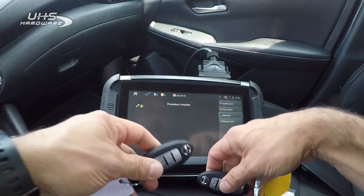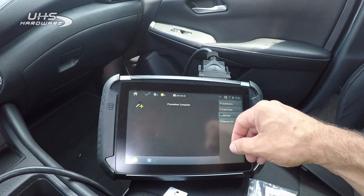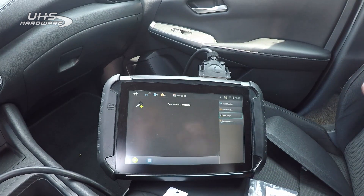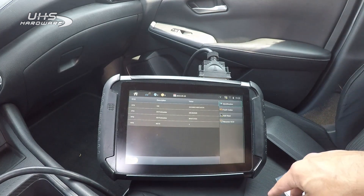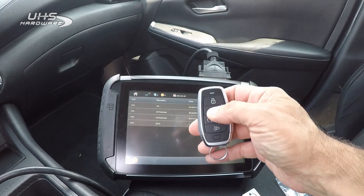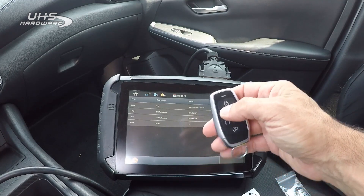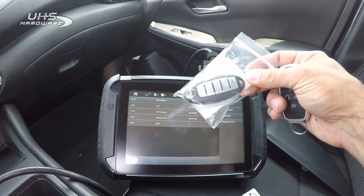We may have to plug in our gateway — I don't know why that one worked without the gateway, but let's plug it back in and see what happens. We're back now, same vehicle. As you can see, we only have one key. Only our aftermarket went in due to the fact that we tried programming a second virgin key.